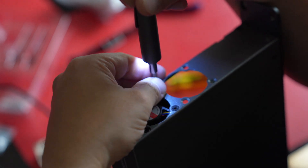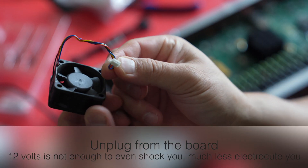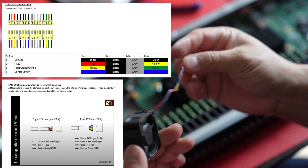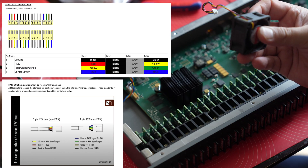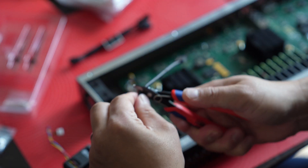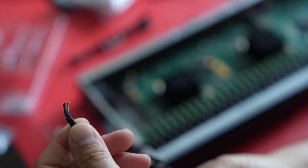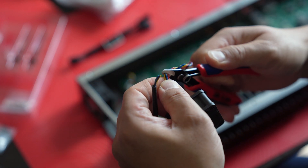Just remove the fan one at a time — go ahead and unplug it from the board. Don't worry about the 12 volts, it's not enough to shock you. Here are the pin diagrams. You want to make sure that you match the corresponding colors, but the big thing that's different is the 12-volt wire: it's red from the board and yellow on the Noctua. Cut enough sheath off so you can get access to the wires — we'll reuse the wires from the old fan for the connection.